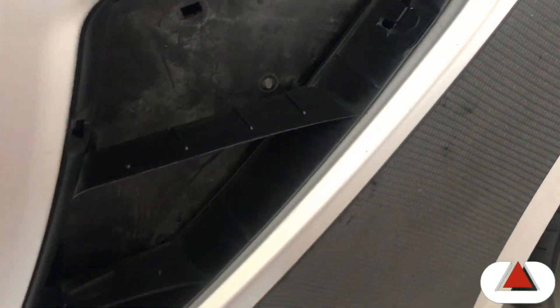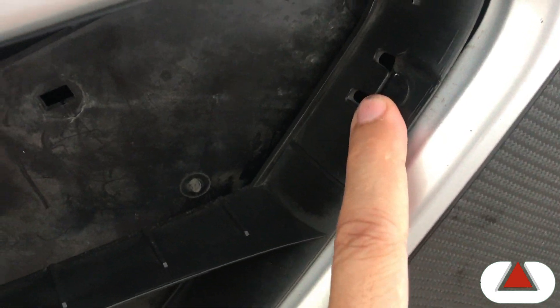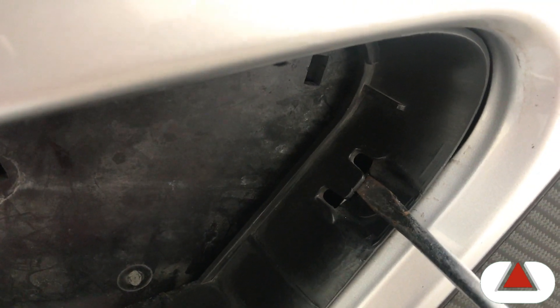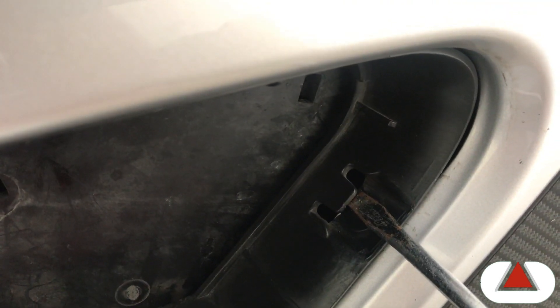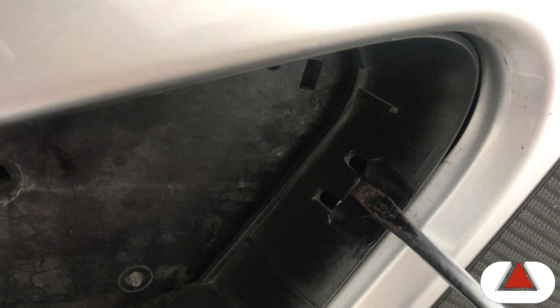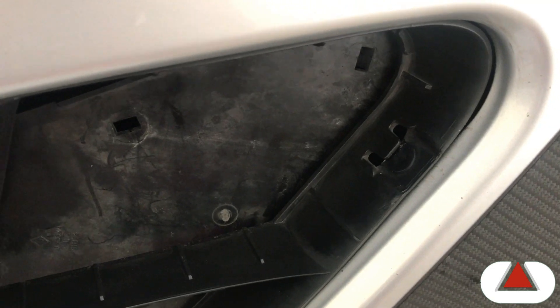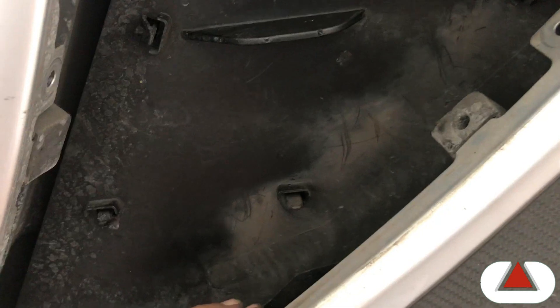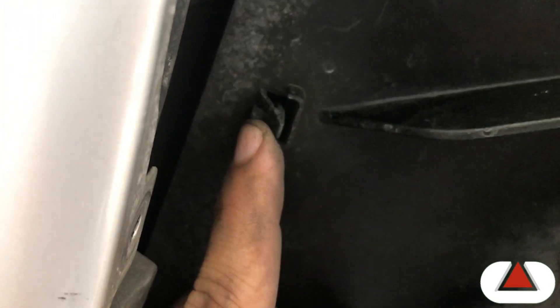This piece over here is one of the easiest ones. You have four tabs — one over here, one there, and two over here. The only thing you need to do is put a screwdriver in that tab and just give it a little twist and pull out on the plastic for all four positions and it should come out easily. This one seems like it's going to be easy because you can clearly see some tabs here that you just have to push back and then the part will come out.